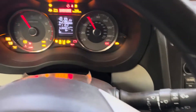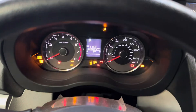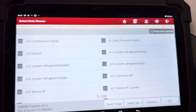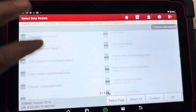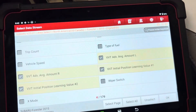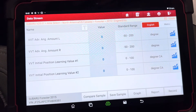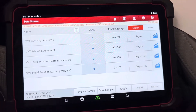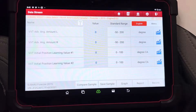Key on. My cooling fan is no longer running. All the warning lights are still up because I don't have the vehicle running. I want to show you the data pins have been zeroed out. Read data stream — we're going to scroll down here to VVT Learning. Zeroed out. It just cleared the data without replacing the ECM, without reprogramming anything, without doing EEPROM work.